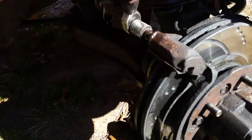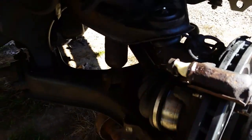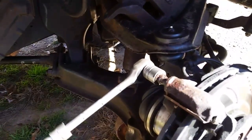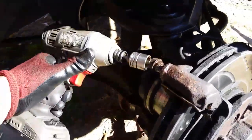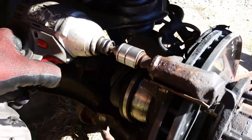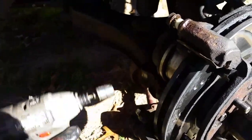I'm going to turn my torch off before I start a fire. We broke it loose, but we've got a little ways to go. We'll put some penetrating oil. What I'm going to do is get my cordless tool, put this socket in there, and let this spin around really, really fast — that'll draw a lot of this oil in there. This is 11/16 — actually supposed to be an 18 millimeter socket. Just spin this bolt a little bit and let that oil get down in there. Don't spin it too fast because it'll get hot and tear that boot up on the inside.